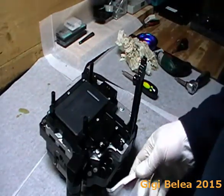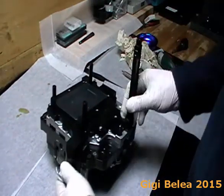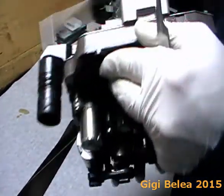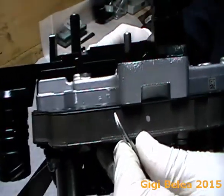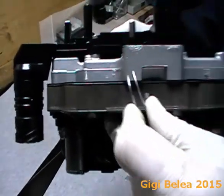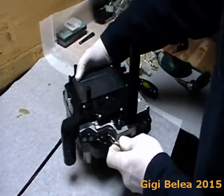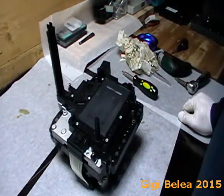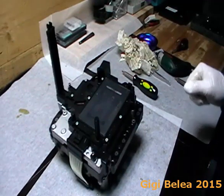As I showed in my previous video, between the valve body parts there is a gasket — it's an aluminum gasket but on each side of it you have a paper gasket, so it's: paper gasket, aluminum, then paper gasket again. This gasket sometimes fails and you will start losing pressure on the unit, and then you have to change the gasket. That's about it for today — thanks for watching, bye guys.